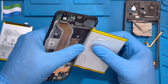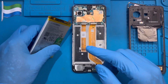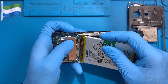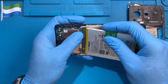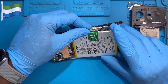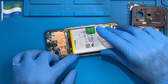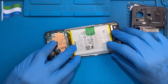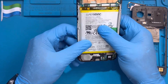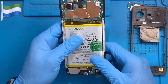Remove the battery. Now it's time to fix the new battery back in. Fix the battery terminal first before you put the battery down so you don't lose the position. Fix the battery terminal first, then put the battery down — it's very easy. Make sure the plastic tab is facing up. Don't put it down the wrong way. Make sure the battery sits properly, then close the plastic so it's up again.